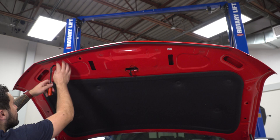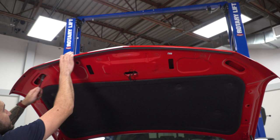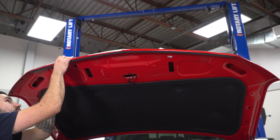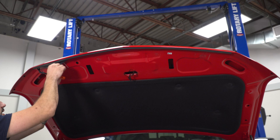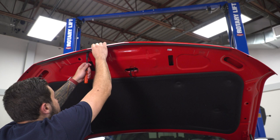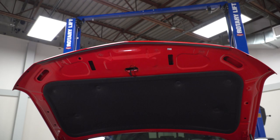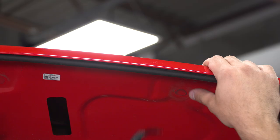Starting here on the passenger side, just go up with the panel removal tool. If you need to, you can bring your hood down — if you're taller it might be a little easier — but you're basically just gonna go up under here and pop them out. Make sure they come all the way out. Remove the second and the fourth one in. So that was the second — move over one, skip the next one, hit the fourth one. Make sure it comes all the way out. Same thing on the other side.